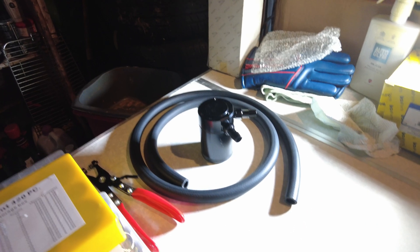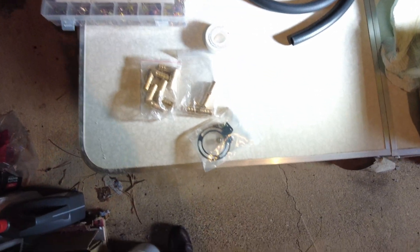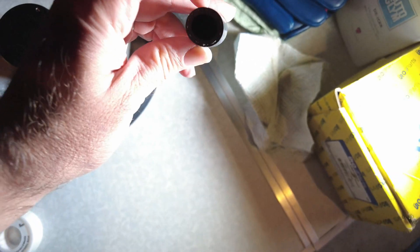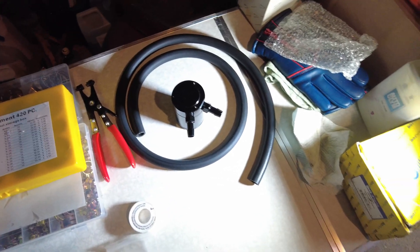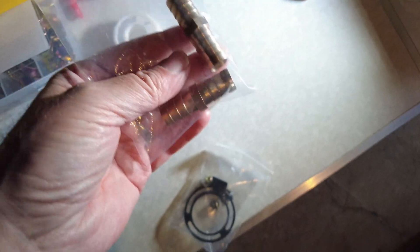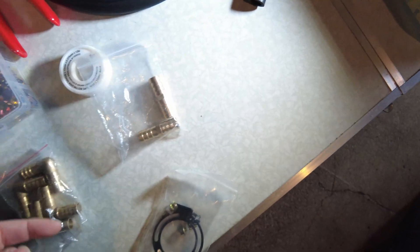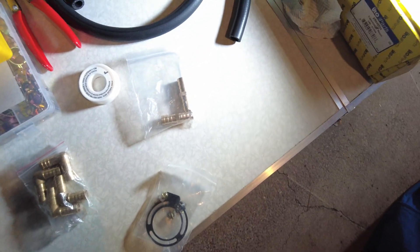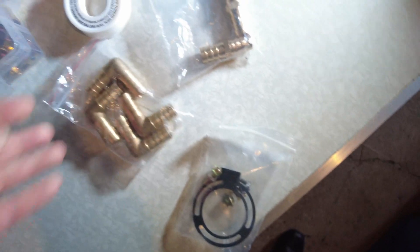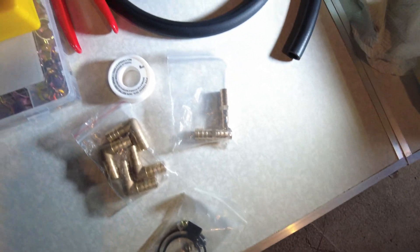Before I do that, I'll quickly go through the accessories. I've got 14mm diameter fuel pipe — proper reinforced fuel hose, fuel grade — don't be tempted to cheapskate on that because we absolutely need to minimize the risk of any fire incidents. I've also got some brass adapters here, again 14mm diameter, to allow me to join the fuel hose with the existing plastic pipes from the PCV. I've also got a series of elbow joiners, again 14mm, which should enable me to do quite a smart job with the plumbing.